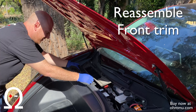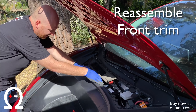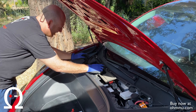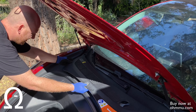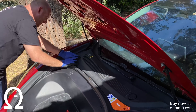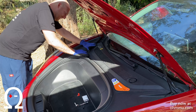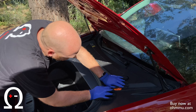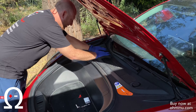You reinstall the air plenum — just align it into its place and then press down on these four plastic tabs until they click. On the top ones, you might have to support the rail a little bit so it doesn't flex too much. Line it up and as you go around it, you'll hear different pops as it connects back in place.